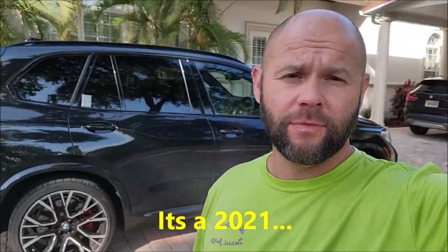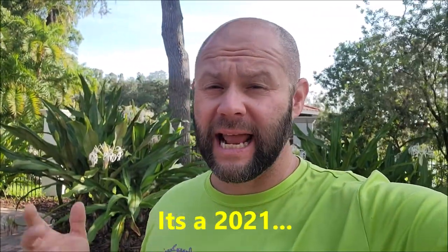Hey guys, it's Gary Dean, detailjuice.com. I'm back with this 2021 BMW X5M behind me. Today it's getting the works — prior to a quick clean-up last time, now we're doing the Everlasting Showstopper X application. We've got to do all the prep: clean it up, clay bar, decontaminate, and then polish. I'll do a one-step polish with Smart Finish just to enhance the gloss. It's relatively new, doesn't really need crazy paint correction — nice metallic in it. Then we'll get a good layer of protection on there. Let me take you around and show you what it looks like dirty.